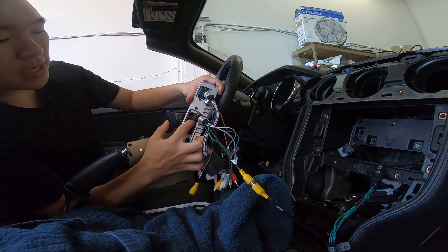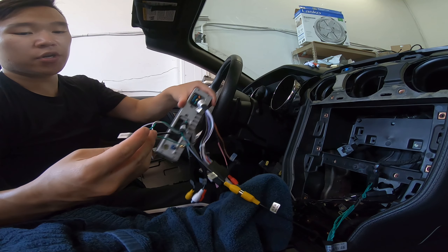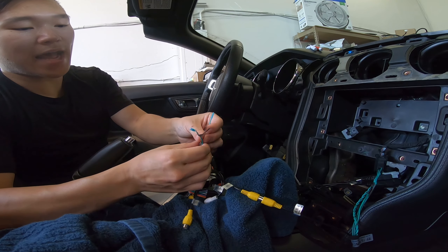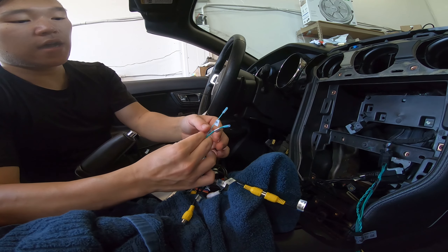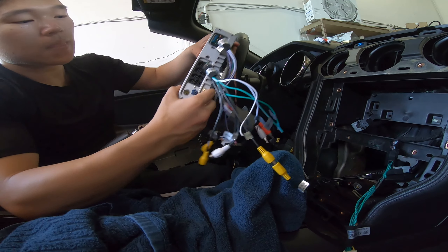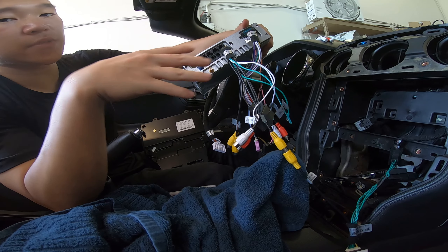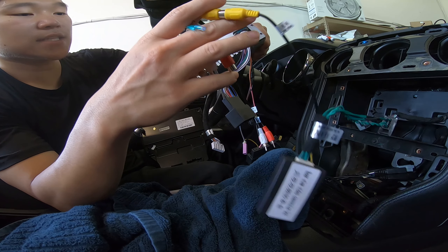They do have a certain shape. If your camera doesn't trigger, there is a green wire labeled 'back' or 'back power.' You might also have one labeled 'reverse' or 'reversing.' Just take out these wires and get it to ACC — that may trigger your reverse screen or trigger the camera to turn on. If the reverse screen comes up but the camera says 'no signal,' maybe you need to power the camera. So that's the camera connected.